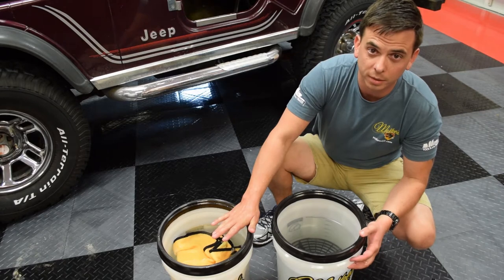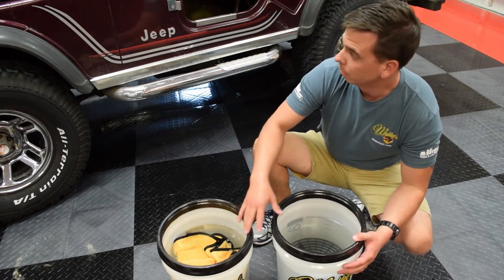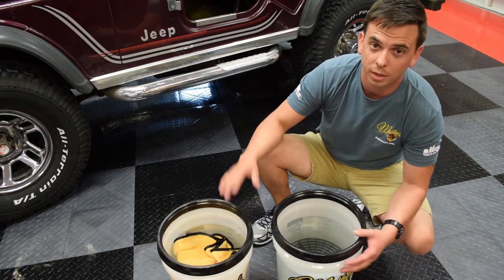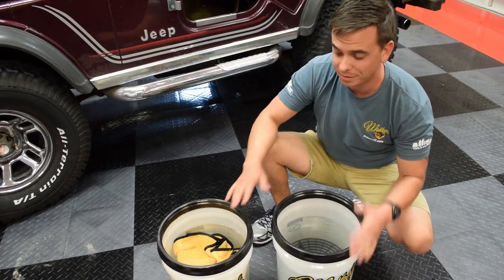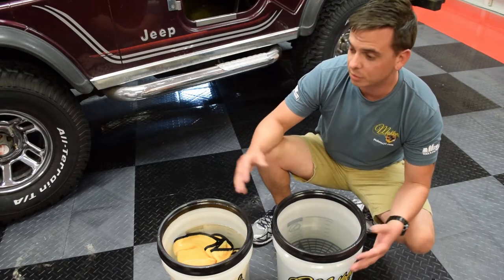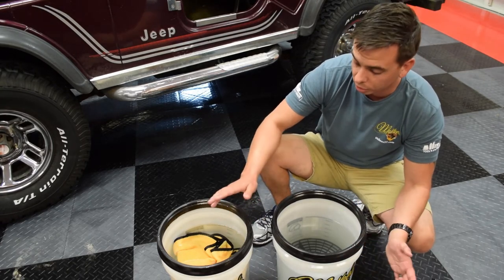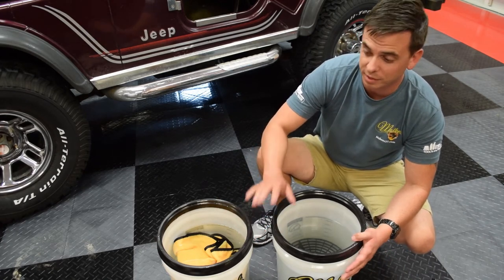I have three towels in this bucket. If the vehicle is lightly soiled, you can get away with using just one wash mitt. A rinseless wash is really simple — you wash one panel, you dry it, and you move on. For doing the wheels and tires, it's best if you use a waterless wash — N914 diluted 1 to 128. Simply spray and wipe. That's the easiest way to wash your vehicle without resorting to a hose and sudsy solution and runoff. If you live in an apartment complex, it's perfect. You want to wash your vehicle at night in your garage, it's perfect. At a car show, it is hands down the most convenient way to wash your vehicle without sacrificing any safety.